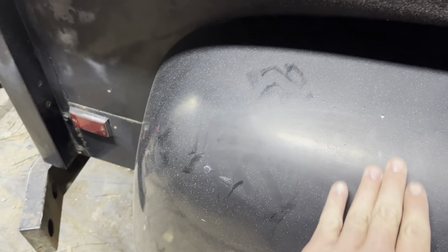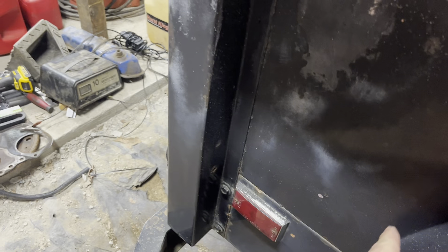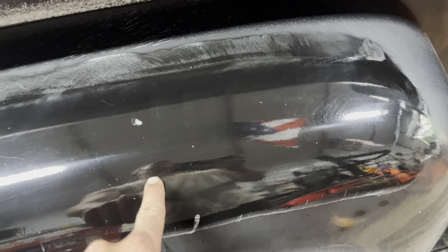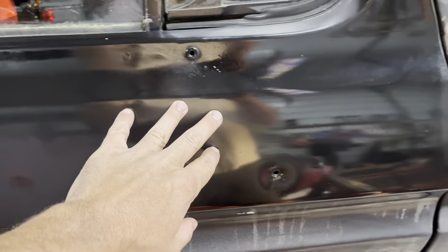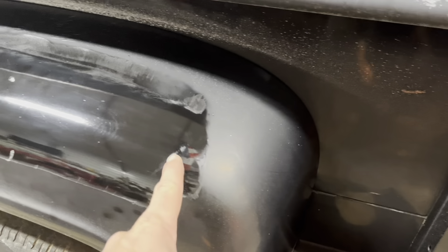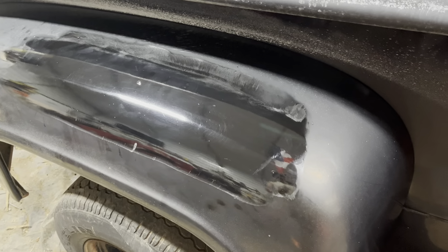Long story short, let's bust one little spot — I hit it with some compound, we'll see what it looks like, and then we're gonna get to work on the rest of it. You can see how faded the paint is. Look at that — that's with one little pass of compound. We sprayed this truck outside at least 17 years ago, one-stage paint, not base-clear. That's a big difference y'all, and that's just one little half-way-done spot. Let's get to it.